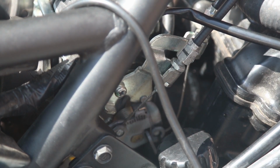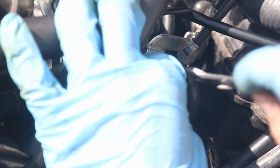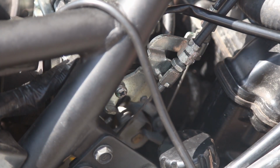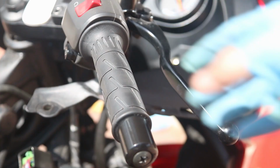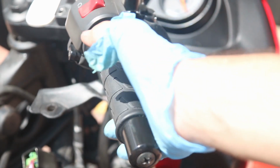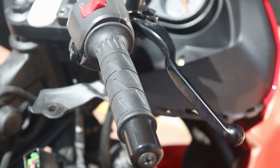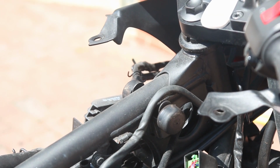It's one of the better ones because it's nice and small, and tighten it. If there's any binding, you should be able to loosen it a bit, or if there's any sort of play, and I see it's actually a little bit off. There we go. That's it. It was binding and now it's perfect. And this is exactly what we want, just very quick to release, and that's it. The carburetor is in there. Now the next step is hooking up everything to the carb.